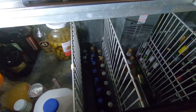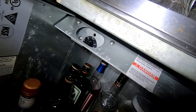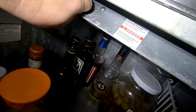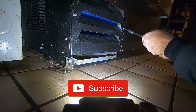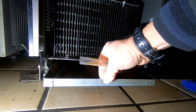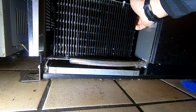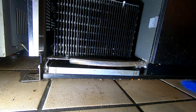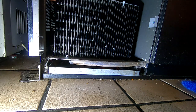We've got a chest cooler here running at about 50°F with the fan running. The thermostat is set at about number six and a half, so it's about as cold as it can go. I don't really see any water down in there. We're going to go ahead and turn it off and take a look, but just feeling it right now, the condenser is not really warm.